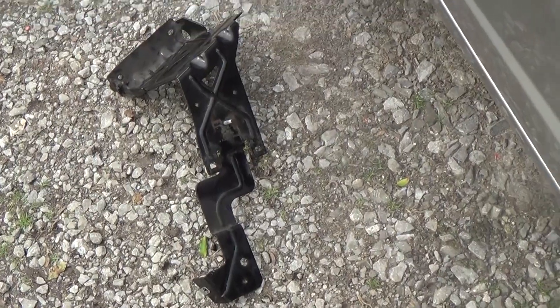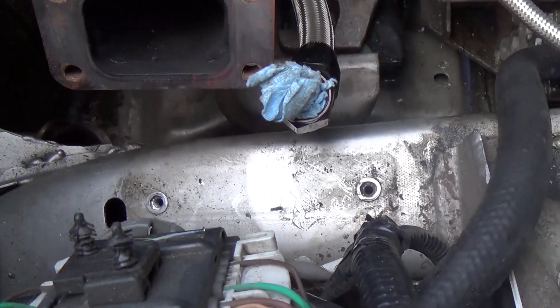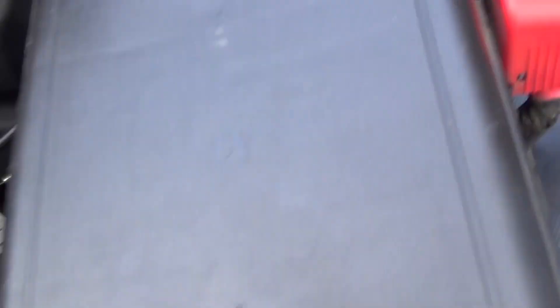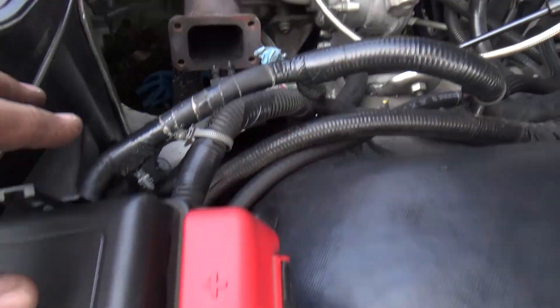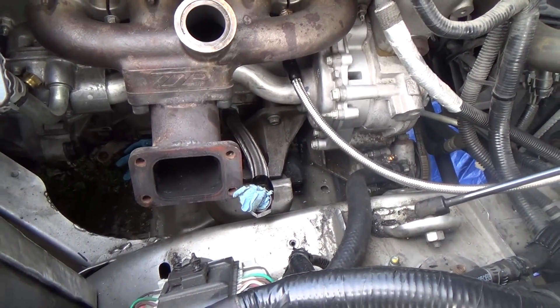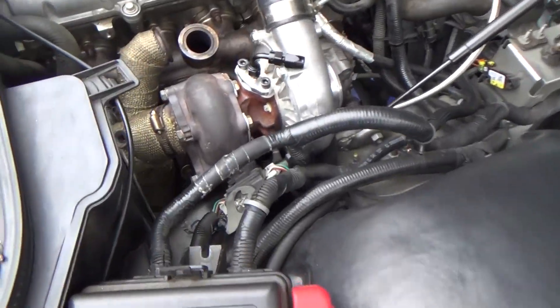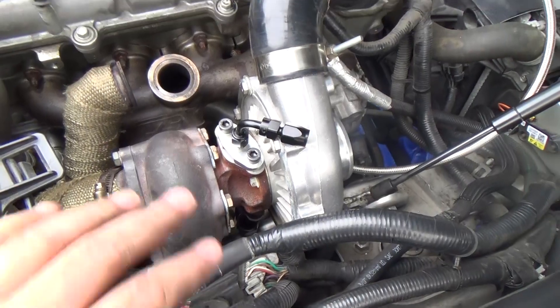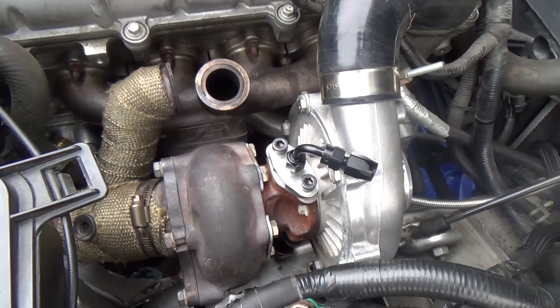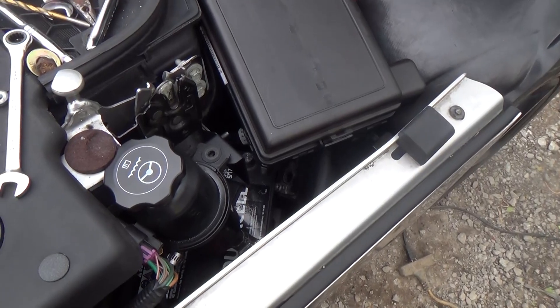We cut one piece off of that bracket. What we're trying to do is move it back a little bit — we're going to drill two new holes in the frame and slide it back and attach it. Hopefully just by moving the whole bracket back, this will move the fuse box back enough to make room for the turbo while still having that metal piece protecting the wiring. We got the bracket marked, put a couple of new holes down there. We took it back out to make room for putting the turbo in, and once the turbo is in we'll put the bracket back and add a hole for the power steering reservoir.